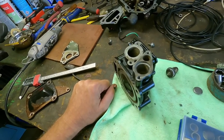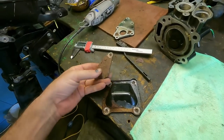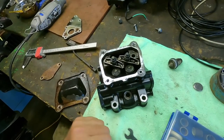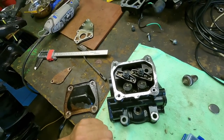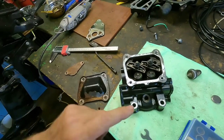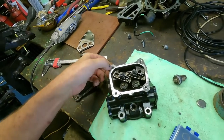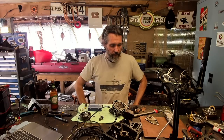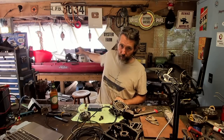In the meantime, just for fun, I'm going to look through my aluminium scrap and see if I've got anything 4mm thick. Let's give these a clean up and a spray — always satisfying. I had three broken bolts — one of the time-consuming disasters. I even put it in the drill press and still made an absolute mess of it. But the reason I'm not so worried is all the head bolts are fine — this is actually just the rocker cover bolts. So what I did was drill all the way through and I'm just going to put longer bolts with a nut on it.